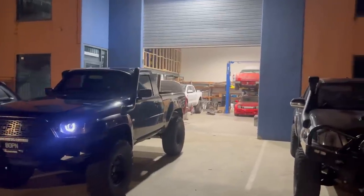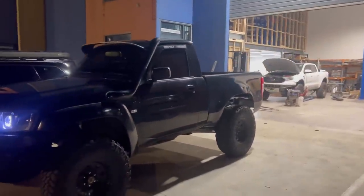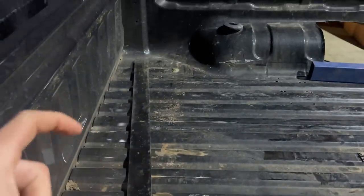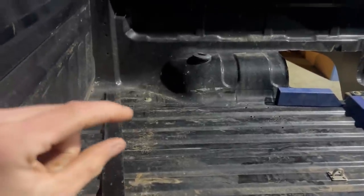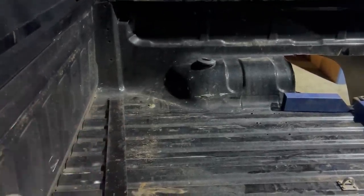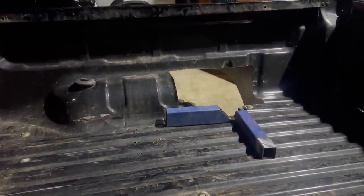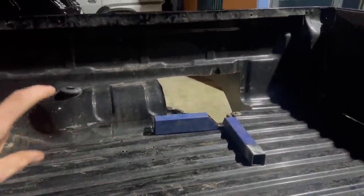I also need to weld the sides where I've cut to suit the Patrol body shape - since I've cut that it's just really flimsy with nothing bracing it. I'm at Jake's now and he's in the forklift getting ready to flex it out and see where it's hitting. First thing we're going to do is fix this gap here - it's currently like 40 or 50mm, so we want to get that much closer. Then I want to use this bit of 75 by 10mm flat bar to brace from mount to mount, and if I remount underneath the steel it should lower it 20mm. You can see it's sitting about 20mm high, and I've started cutting out the wheel wells because it was hitting after a few inches of up-travel. Now I can tuck the 37s, but we're going to fully flex it and see if we need to take any more out.